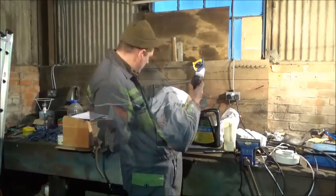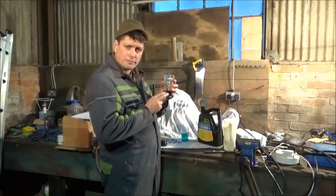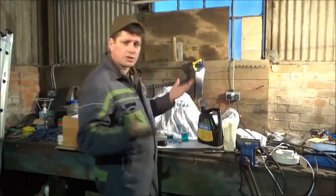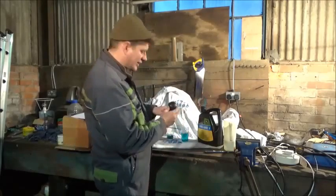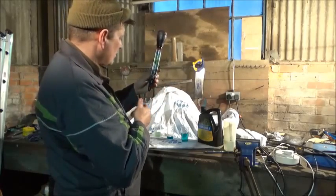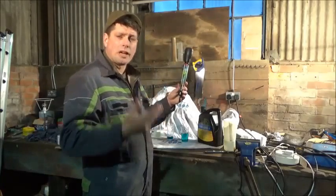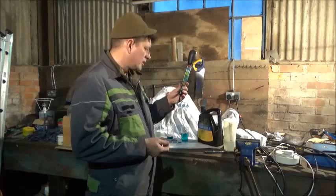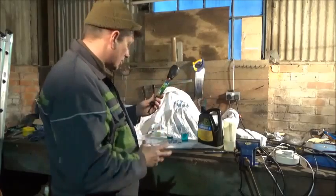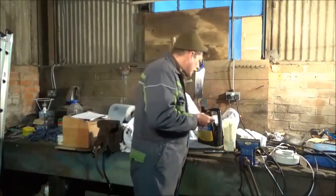This is pure coolant antifreeze with no water added at all. So in theory you'd think it should give us minus 50 or at least give us six discs - but it's still only giving five discs. So there comes a point where you can actually add too much antifreeze coolant. You'd think you'd get all six discs because it's a strong pure mix, but you don't - there's a little lesson for you.